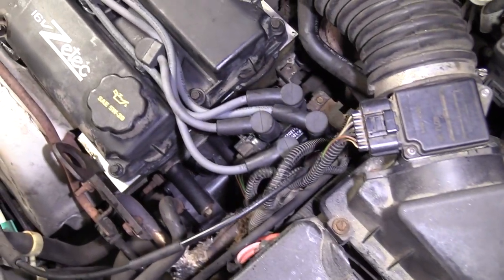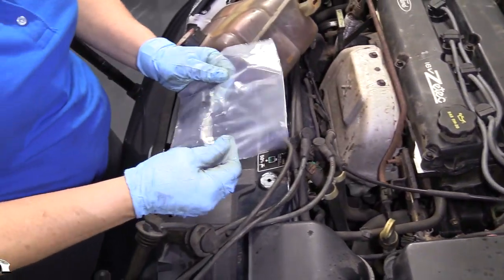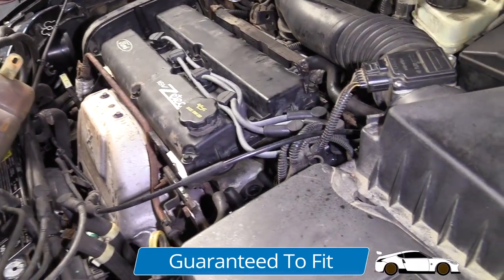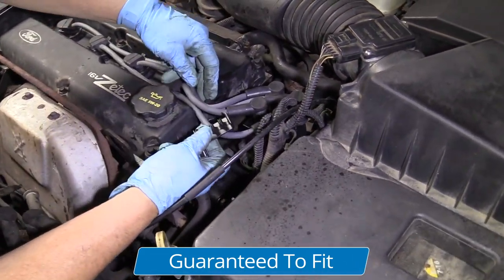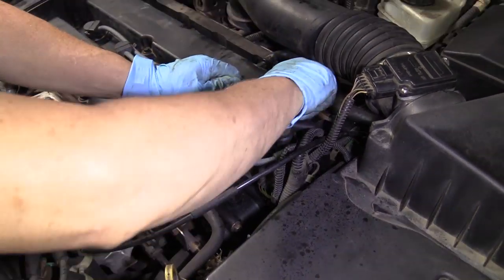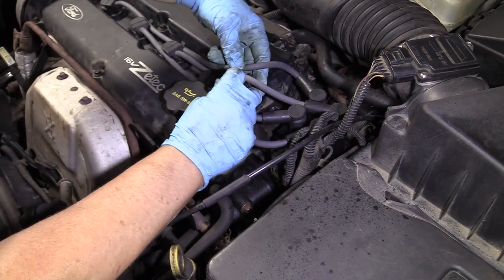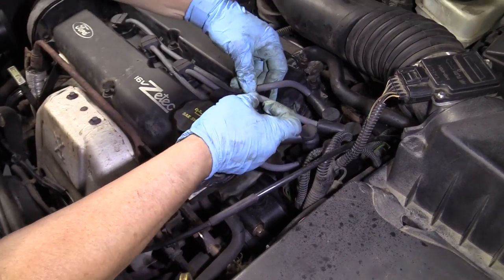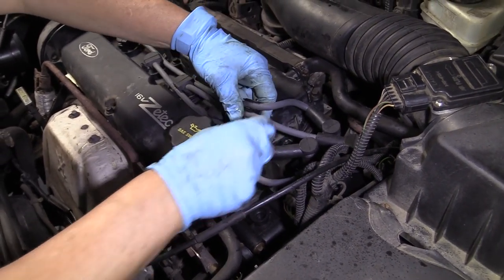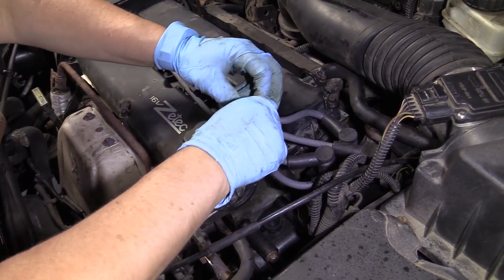This package came with new plug wire clips. It's pretty important to keep your plug wires separated and not overlapping or touching. In the old days, they told us that overlapping wires would actually interfere with the spark. So I'm going to bring this underneath and keep it separated. It makes it look clean too.